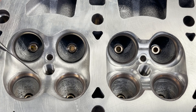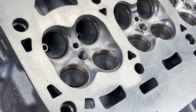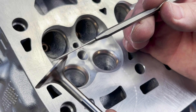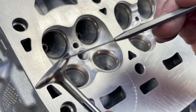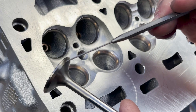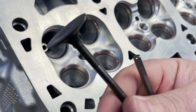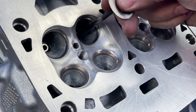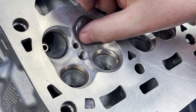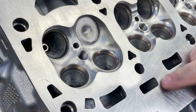The other part of this is it's going to blend the combustion chamber into the valve job — right into the top angle of the valve job. To get that done, we take a valve — just a regular valve — and this is the margin right here. What we do to protect the valve seat and blend it all in: we take the 45-degree angle that the valve usually sits on the valve seat with and we make it razor sharp, like this. Because it's razor sharp, I can put it on the valve seat and it completely blends in — no edges.